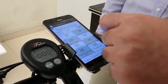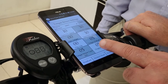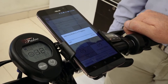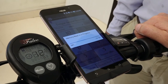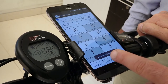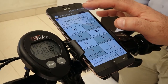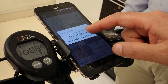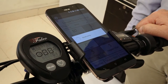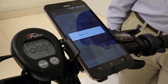This is the torque sensor settings screen. There are eight parameters: turn on speed, turn on delay, base torque, turn off delay, flip axle, torque multiplier, torque sensor turn on, and dropout offset. I can hit memory read to see what is inside the motor. It reads successfully — it shows speed or torque sensor. So I'm going to go to sensor selection and change it to torque and speed sensor, then hit broadcast to tell the motor to switch, because that gives us the most natural riding experience.